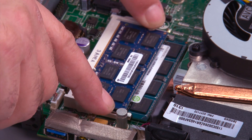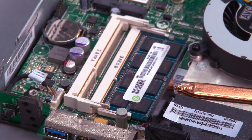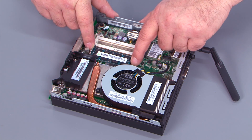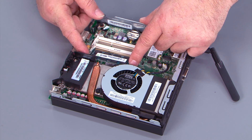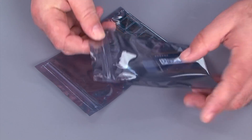Slide the hard drive and lift it from the post. Press outward on the latches to release the memory. Pull it out of the slot. Do the same for the other memory module. And here we have the new memory modules in the anti-static bags.